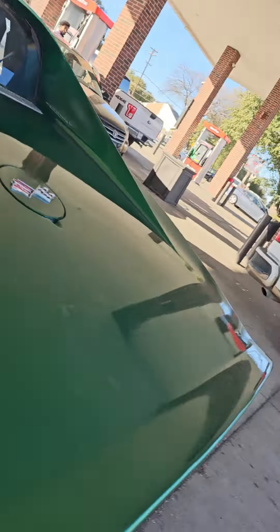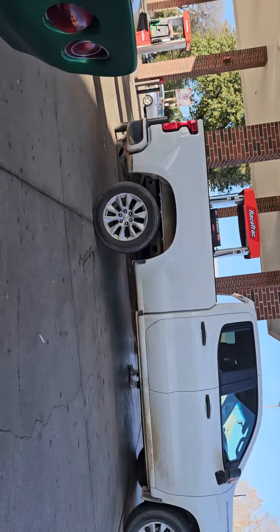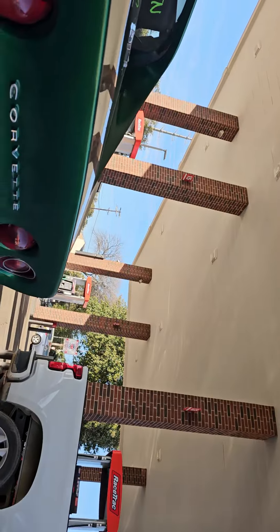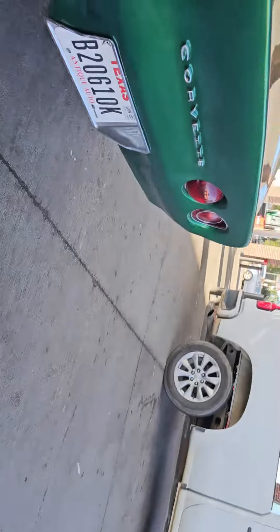That thing is super cool, I like it too. What is that next to the center? That's a crankcase breather — because it's a nitrous motor it's got a little big ring gap, so it builds up crankcase pressure. So you don't just have it dumping out straight down.